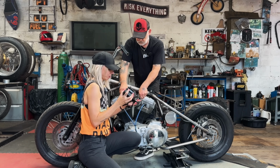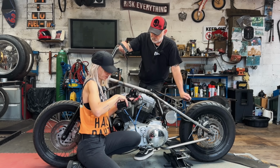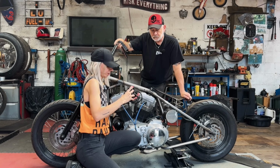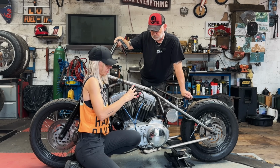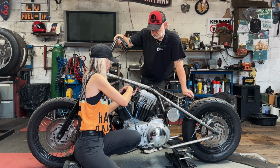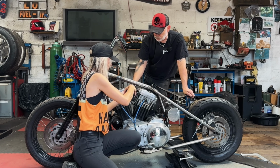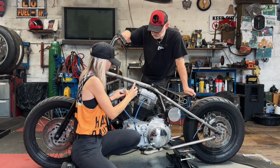So I'm getting rid of this top, and it will be bolted straight on there. So I'm cutting all this off, and the choke mount will be somewhere different. I haven't decided yet. This will come off. It will have a plate welded on here so it can be bolted straight on, as far inside as it can go. And to make it neater, I will cut it up to there, and it will mount here on the frame. Get rid of this boss with a little bracket coming down there. Voila.